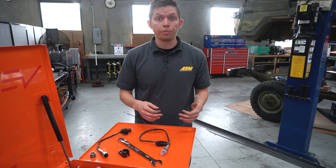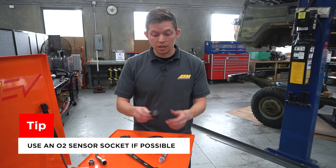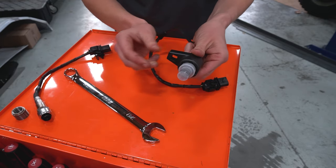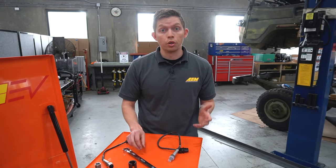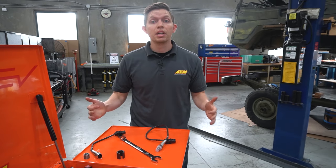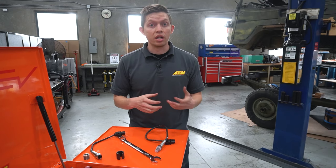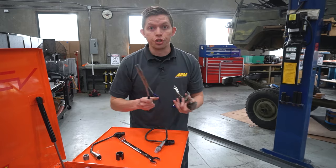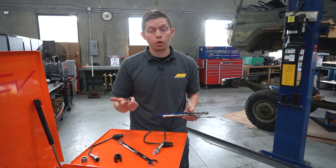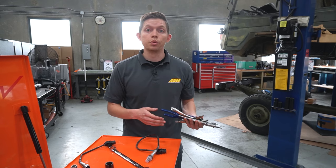When installing the sensor, make sure you have the proper tool — the correct O2 sensor socket, sized at 22 millimeter or 7/8 inch. These sockets have a pass-through for the harness so you can slip it over the sensor and apply the right amount of torque without damaging it. If you don't have an O2 sensor socket, a 7/8 or 22 millimeter wrench is the next best option. Avoid adjustable wrenches, channel locks, vice grips, or needle nose pliers — they can strip the sensor, damage the body, or mar up the threads.